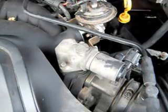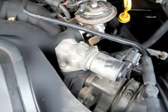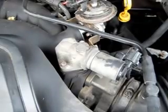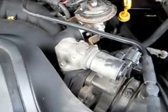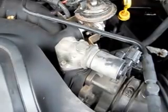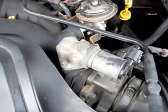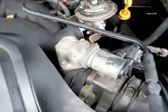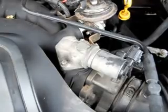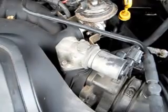With gratitude to other YouTube posters with Ford Escape problems, I'm going to try and determine today if I have a bad idle air control valve. The symptoms are: the motor starts immediately and will not idle. If I race the motor for a while it sputters around three to four thousand RPM, and as soon as I let my foot off the gas the motor immediately dies.